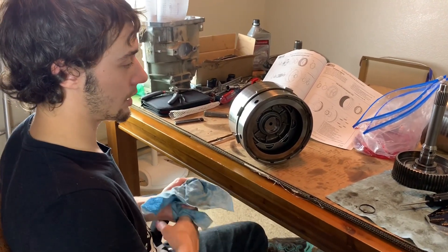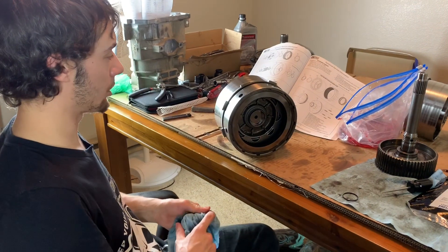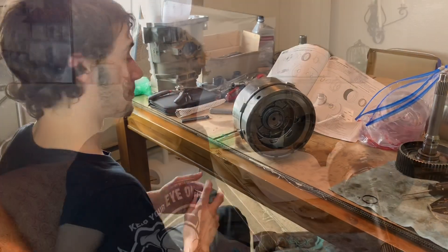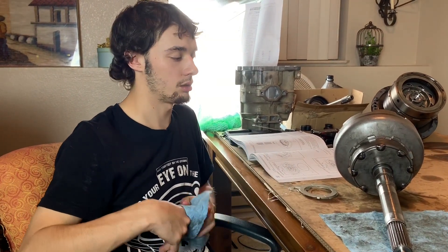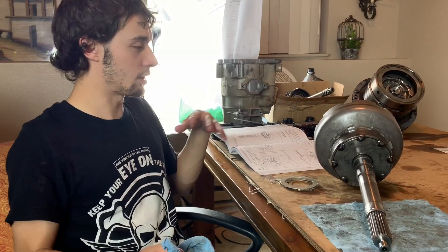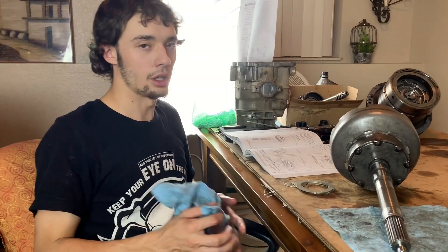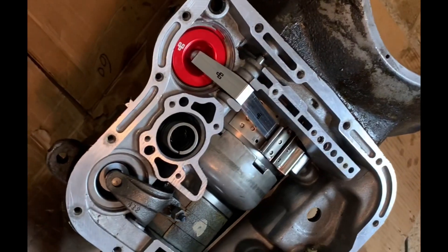Next I'm going to move on to the intermediate shaft and gear train assembly, and after that I'll be pretty close to done. I got the intermediate shaft and gear train assembly back together, put new thrust washers in it, everything looks to be in spec, and there are no damaged components. With the pump and the front everything ready to go, I'm pretty much ready to start reassembly on the case itself — putting everything back in. Everything is pretty much put back together.